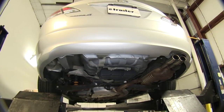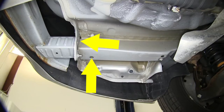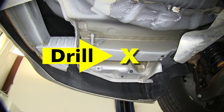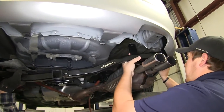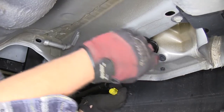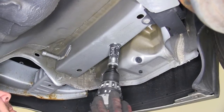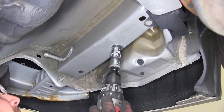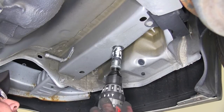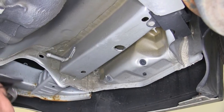We're going to have a total of six attachment points. We have four pre-drilled holes — two in the rear portion of the frame. Forward of the frame, we'll be drilling out an access hole, which will also serve as an attachment point. We'll get an extra set of hands to help hold the hitch up into position so that we can use a paint marker to mark out the forward attachment hole. With the forward attachment holes marked out, we'll bring the hitch back down and set it aside, and using a hole saw bit, cut out our large access hole and forward attachment point. Be careful to stay away from the edge of the frame, as you do not want to drill into the edge — you want to stay in the flat bottom portion of the frame. Also keep in mind, each process we do here on the driver's side will get repeated identically on the passenger side.